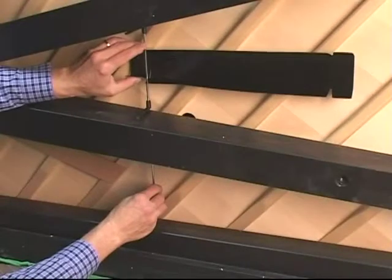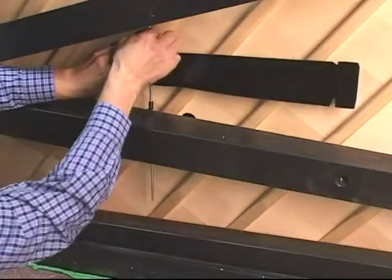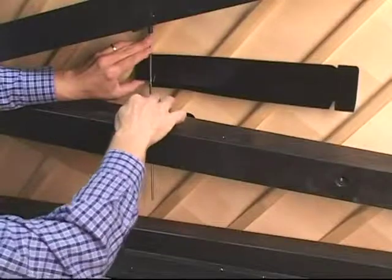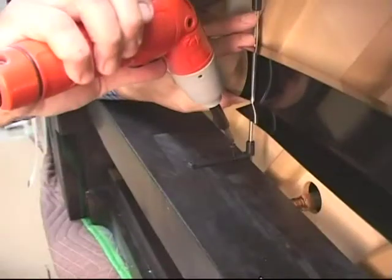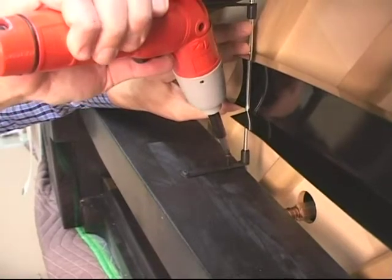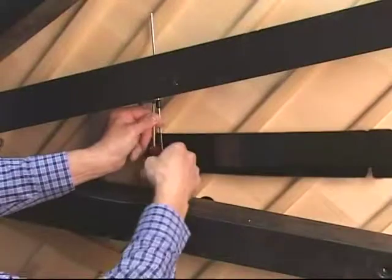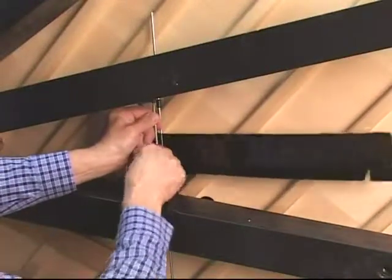In positioning the hanger rod and baffle, to begin, use only one screw to hold the bracket, because you'll need to move the baffle and hanger rod assembly back and forth slightly to determine the baffle's most relaxed position. Then you'll tighten both screws to anchor the bracket. Perform the same operation for the other hanger rod and hanger rod bracket.